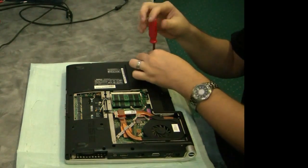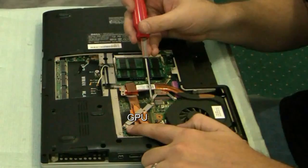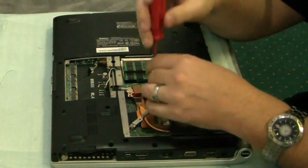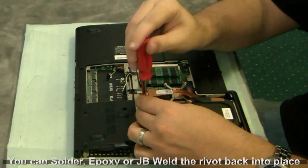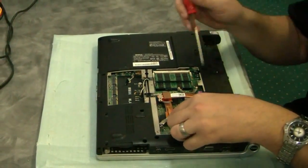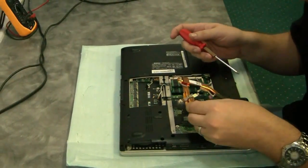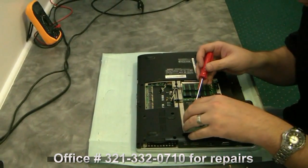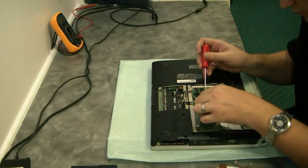This is actually a re-repair on this laptop. What's very typical on the XPS series is that next to the GPU — which the GPU is where he's pointing — the actual rivet that you screw down into breaks off of the board. You definitely want to epoxy that back in place. I recommend JB Weld, or you can make up a little bracket to hold it back in place. We get a lot of stuff in from all over the country that other shops have worked on. The tape that you see on there is just to keep the chip from shorting out when the copper is on top — that's good standard practice.